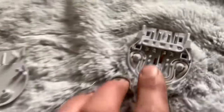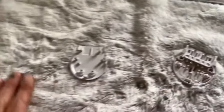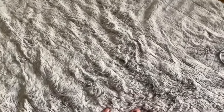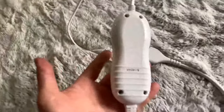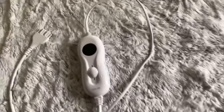You can see there's an in and an out for the actual element itself, so it runs through the entire electric blanket. I ran my fingers along the entire element to check for any breaks — if there's a break it would explain why it wasn't working. I didn't find any breaks, which led me to think perhaps there was a kink in the element. A kink creates resistance, and that resistance would be detected by the safety switch and throw it, preventing the blanket from working.